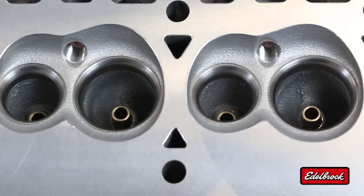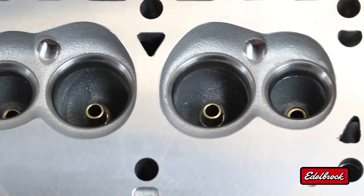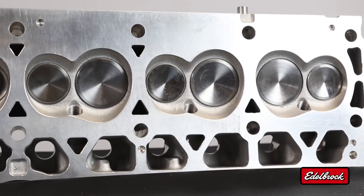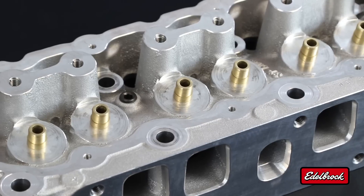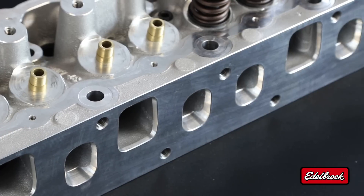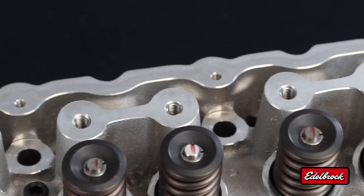This head has been designed to fit on 4.2-liter AMC blocks for either retrofits to those blocks or strokers. When running a factory 4-liter head on a 4.2 block, there are water passages on the deck of the head which need to be blocked off due to the scalloping of the bores on the 4.2-liter block. When designing this head, we've eliminated those particular water passages so no modifications are necessary to the head itself to run on a 4.2-liter conversion. What you do need to make sure you do is get the proper intake and exhaust manifold combination to go with the cylinder head — that would be a 1991 to 2006 intake, and 1991 to 1998 exhaust or aftermarket header. And as you're assembling the head, the other critical thing is verifying that you get the proper push rod length.